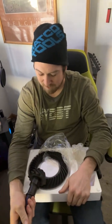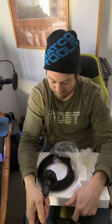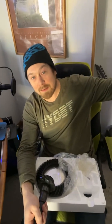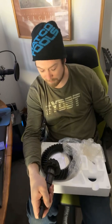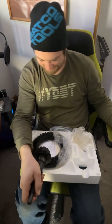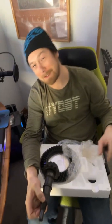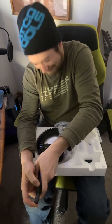When the driveshaft spins, it spins the pinion gear, which in turn spins the ring gear, and the ring gear spins your axle shafts that spin your tires. Why do you only need one? Because you only have one rear end. There are two rear tires, but they share the same rear end — an axle shaft goes from each tire to the rear end. One rear end, like a person.